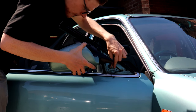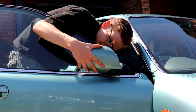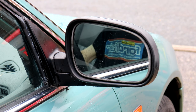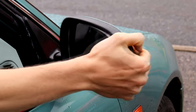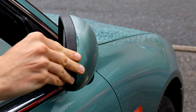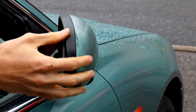The new mirrors slot onto the doors, feeding the wiring through first before bolting the mirror into place. The new mirrors retain the power adjustment but fold manually. It turns out that working power folding 600 mirrors are hen's teeth these days, and not only are these mirrors well sprung and rigid, but ditching the power folding means there's one less thing to go wrong. With two colour-coded and tight mirrors now fitted, I'm calling that a win.